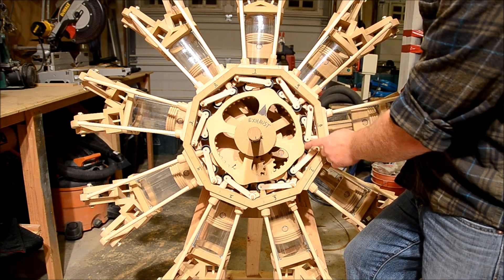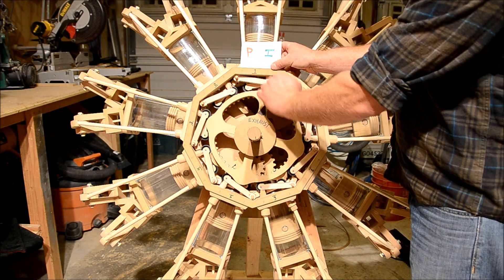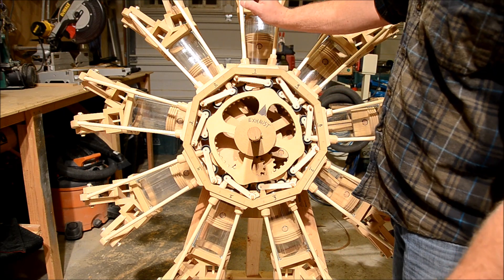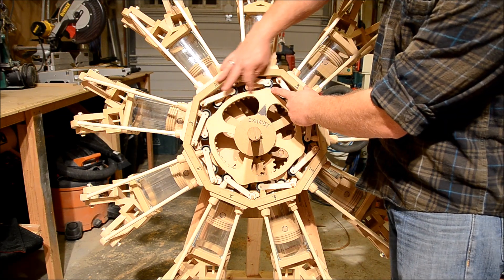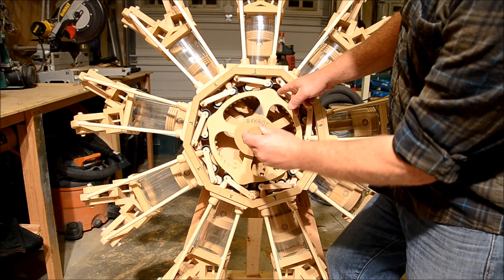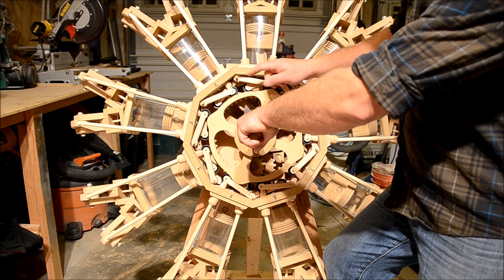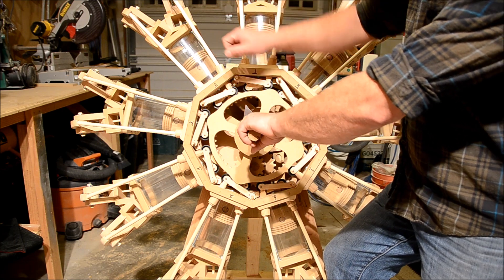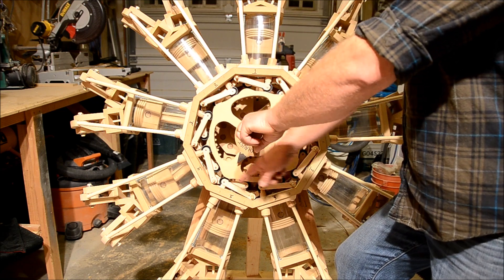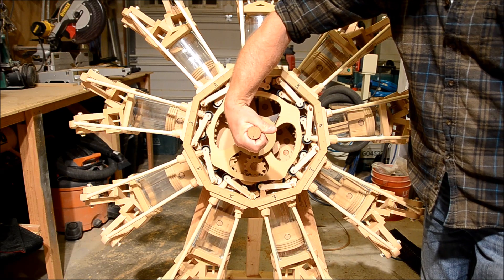I just made two revolutions with the crankshaft while watching the lobes on the exhaust side of the cam ring hit every other lifter. But remember, every other cylinder has a power stroke and then an intake stroke — the same thing applies to exhaust: every other cylinder has an exhaust stroke and then a compression stroke. We can see that with the dead space on the cam ring between the two lobes. Starting with number one at top dead center of its exhaust lobe, the piston is on its way up pushing exhaust out. Number three is next for exhaust, but number two is going up on compression. Then number three on exhaust, number four on compression, number five on exhaust, nothing happening with six — it's on compression — seven on exhaust, eight on compression, nine on exhaust.